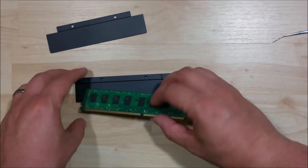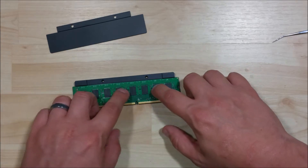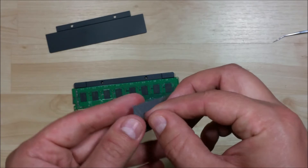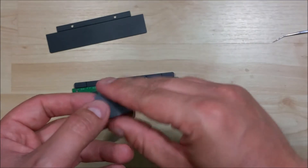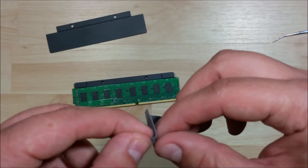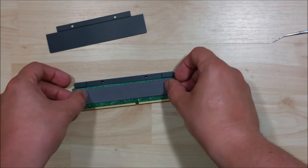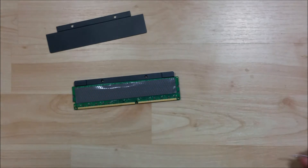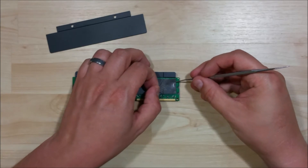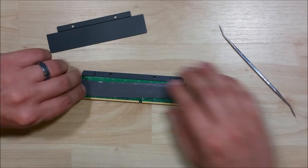With that done, we're going to go ahead and put it into its housing — just butt it up right at the top, and make sure it's centered left to right. Then we're going to take our second strip of thermal tape, thermal compound here, and do the exact same thing. I did find it easier to actually put the tape on top of the RAM itself and then pull the backing off — that seemed to work a little bit better. Just try to hold it down and peel it back. What you can do is basically just move it a little tiny bit, hold it down, and move it a little bit more if you're worried about it extending.